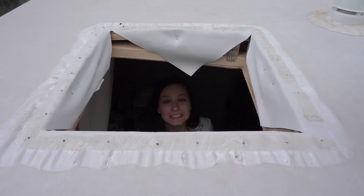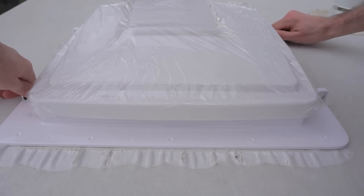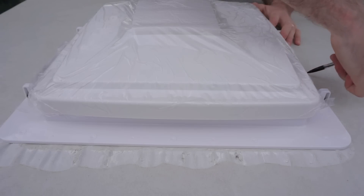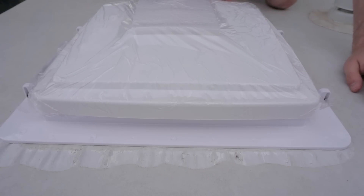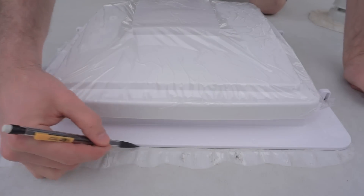So I'm going to apply butyl tape to the underside of the flange for the Maxxair fan, and that's going to help seal it in. I'm going to cover up all the screw holes on that flange, and that's what'll basically seal it to the roof of the RV. I marked an outline of the flange in pencil just so once I put that butyl caulk on the underside, you only get one shot — once it's on, you don't want to be picking it back up. So I'm going to set it straight down on that outline.